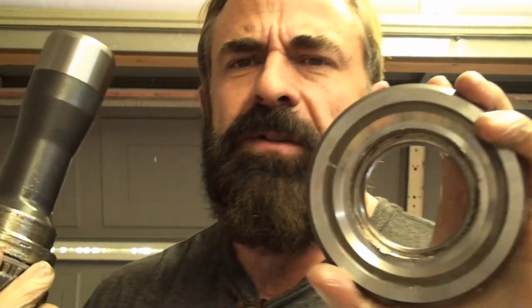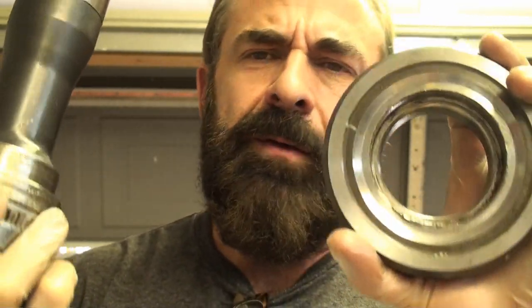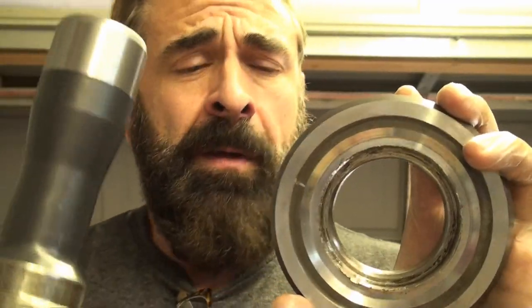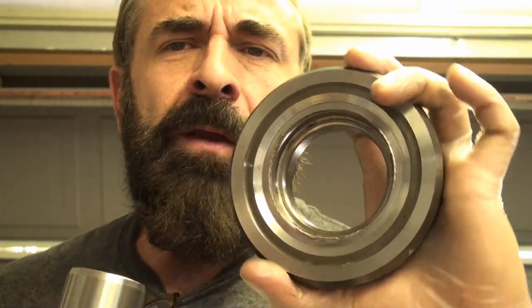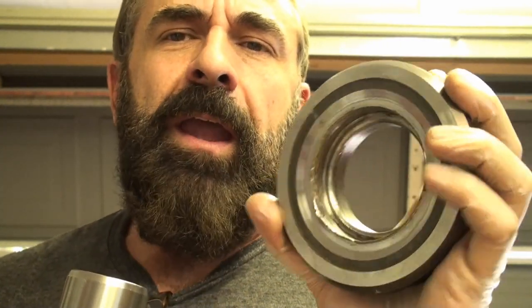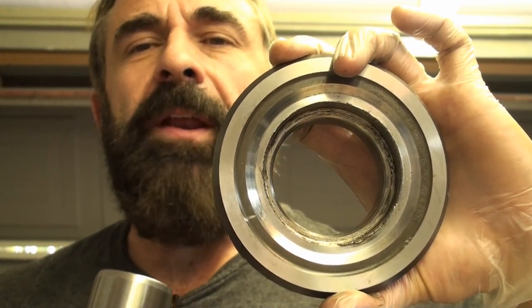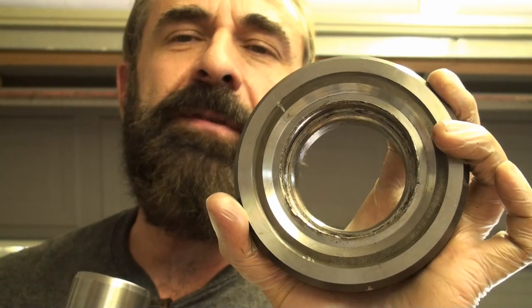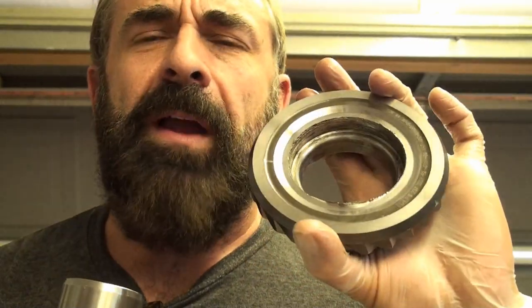And it's a very interesting press fit, because it's stepped. Based on all the research I had done with Volvos and all that, I think with the Volkswagen, this is designed to be the failure point to protect the transmission, engine, or whatever. So this is designed to give at some crazy amount of foot-pounds where this will pop or spin. And it's possible that it could pop, save your system, and probably still hold. But if it keeps popping and popping, it's probably going to get worse and worse, like mine was.